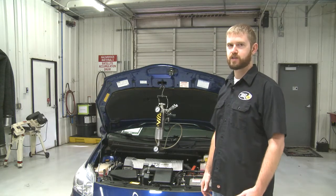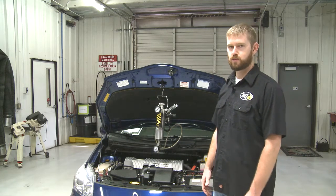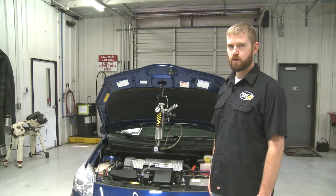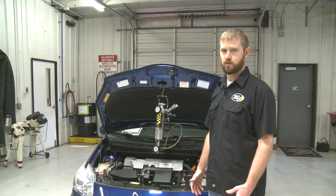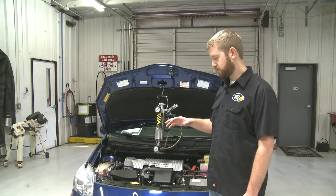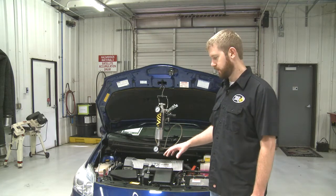There are a few extra steps you have to take when doing fuel services on these vehicles, because the vehicles will not run at an idle normally. But what the OEMs have given us is a way to put them in maintenance mode or engine mode. You're going to have to refer back to the OEM on what procedure to put that vehicle into that mode.